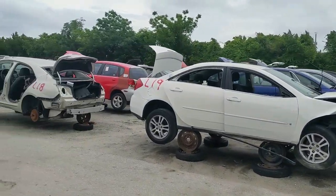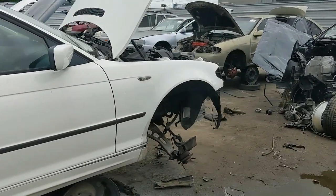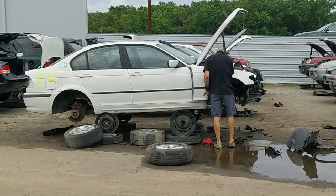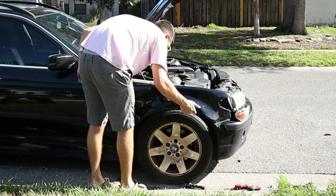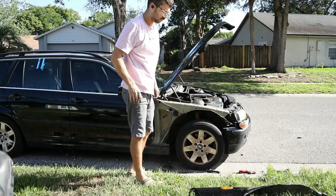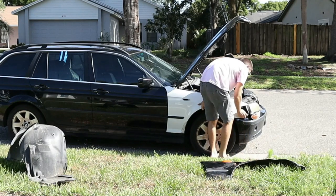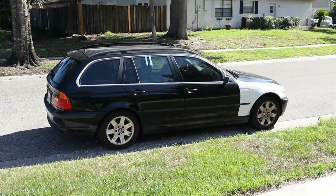The car was involved in a little accident — it looks like someone had side-swiped it, starting with the fender. So that was my first priority after I bought the car: making sure the whole body was straight. We went to the junkyard, bought an OEM fender from another car, pulled the one off our car to check for damage underneath, and test-fitted the new fender to make sure all the body lines were perfect. They looked great — huge motivation for this build. I called this thing my zebra car because of the mismatched colors while it was unpainted.